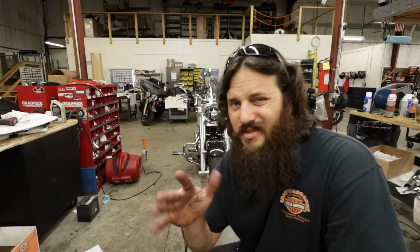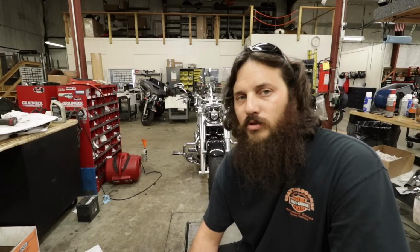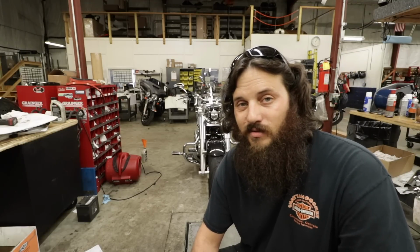Did my final oil check, 4.5 quarts, 4.67, something like that. Right in there was the total amount of oil used, which is way up from 3 quarts in the old Softails, which means this bike will likely run a little cooler. And that oil is not right below the seat, but it's below the transmission now, which is awesome.